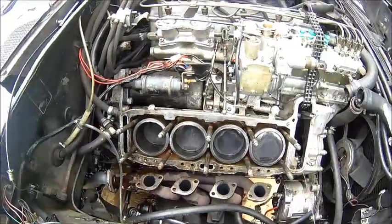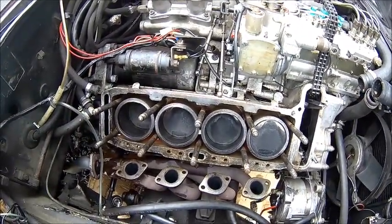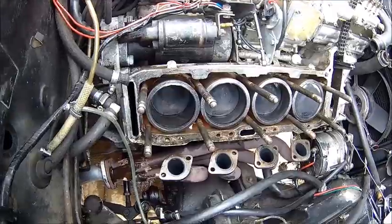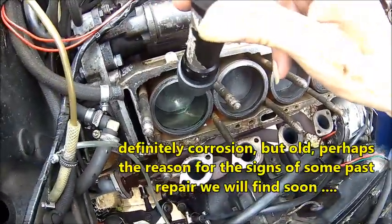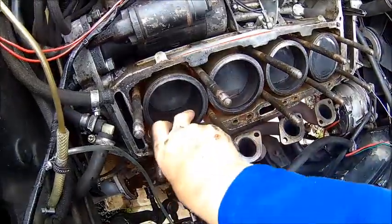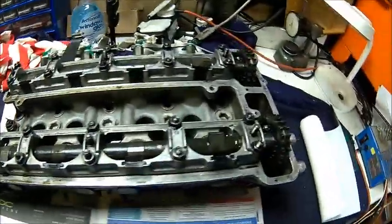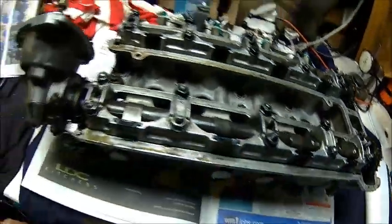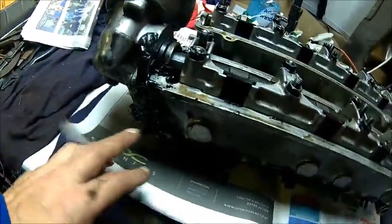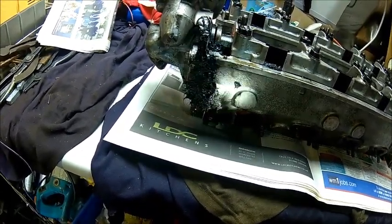That's how it looks out. We got a few issues — it looks like the surface wasn't well prepared when it was done several years ago. We got some weird pitting on cylinder number 4; it almost looks like the cylinder was leaking and fluid was leaking into the cylinder, and there was actually some rust groove. Looking at the underside, we need to suck the oil out. Apparently this was leaking — there's a gasket here and it's very hard to get off, so someone tried to fix it with silicone. It doesn't look very professional, and it was still leaking.